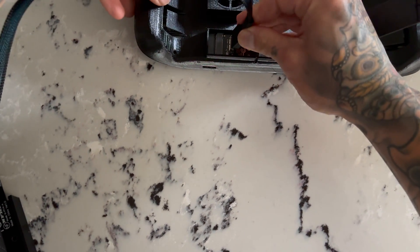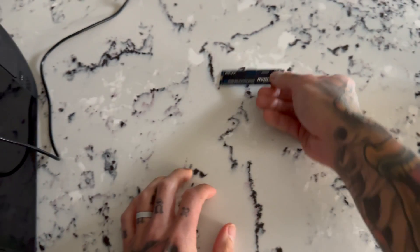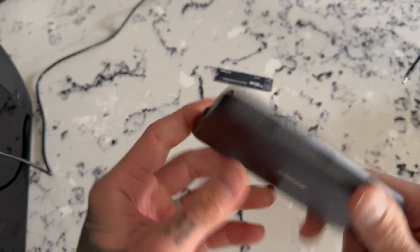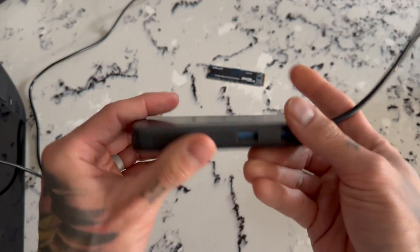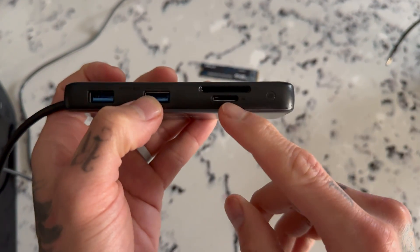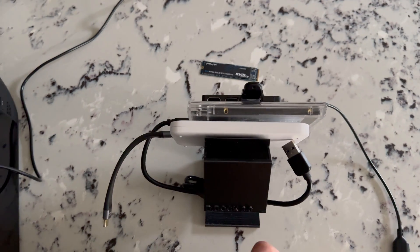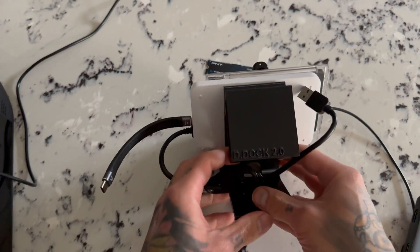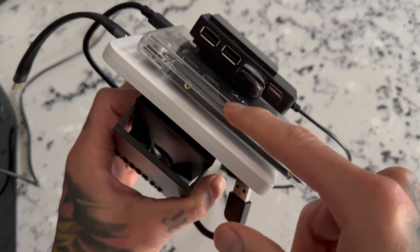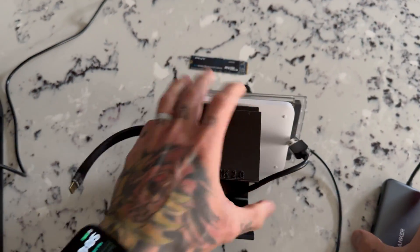Next, plug in the Oculink cable to the Steam Deck. The biggest headache is that we can no longer use the internal SSD, so we have to start dongling. I like to use the Anker 757 — a 10-gigabit dongle with up to 100W PD and 10-gigabit Ethernet. You technically don't need this much; 5 gigabits can work, but I used this in case there are bandwidth overhead limits. I also 3D printed a kickstand to attach two 2.5-inch SSDs — one with the OS, one with games — plus a USB-A dongle for peripherals.